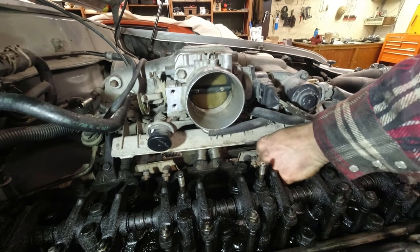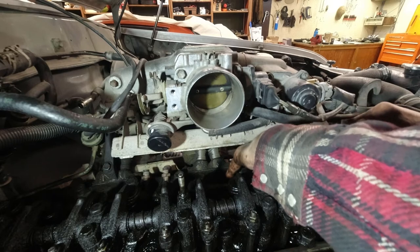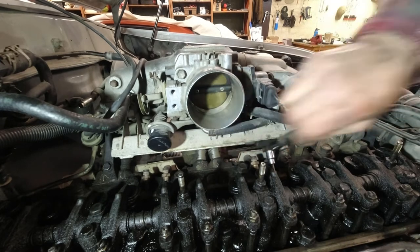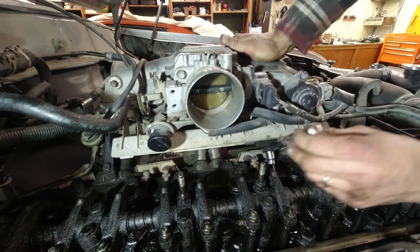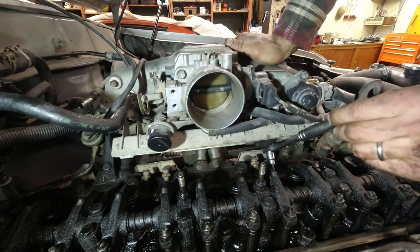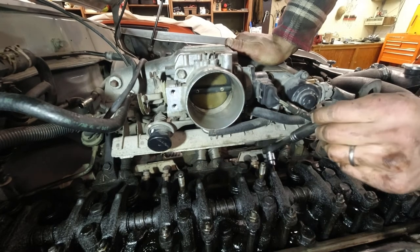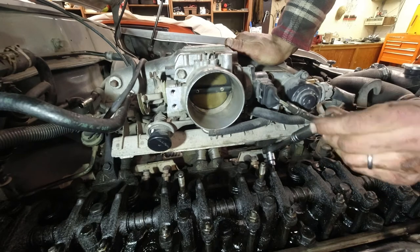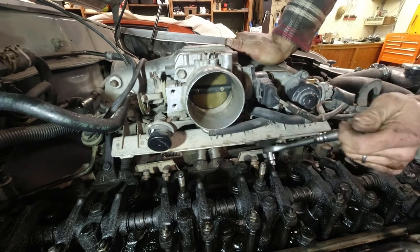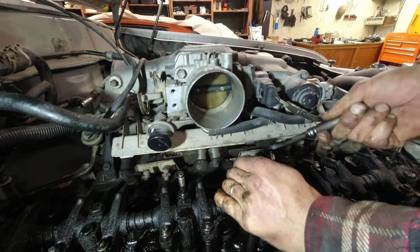It started to get a little more stiff. See if we can fit this on there. All right, got that in. And again, we're talking about an aluminum head, so I don't want to go too tight. It's squeaking at me, but it's not very tight. You know, the injectors that I pulled out were not super tight, so I'm not gonna go any tighter than that was. I'm kinda curious if these bottom out at any point. I think I'm just gonna stop there.